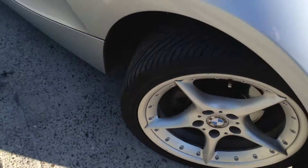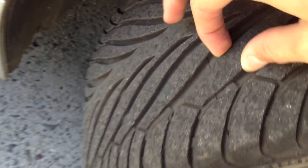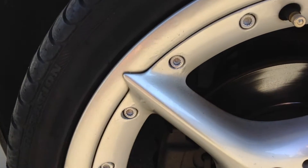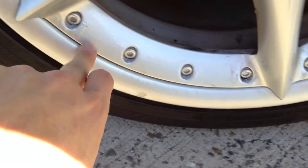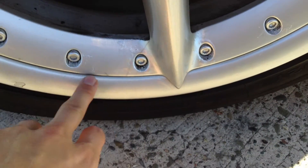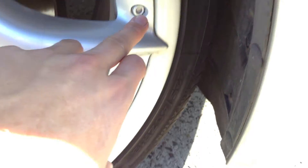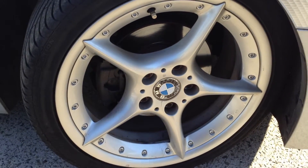Starting with the offside front tyre first. Taking a good look at the tread depth, you're looking at easily a good 5mm of tread there. Looking at the alloys — you do get the M Sport alloys. There's a slight bit of paint bubbling around the alloy; it's just corrosion from the edge of the vehicle. A little bit of paint peel, a little bit of bubbling around this section, but no sign of any curbing or scuff marks at all to the alloy.